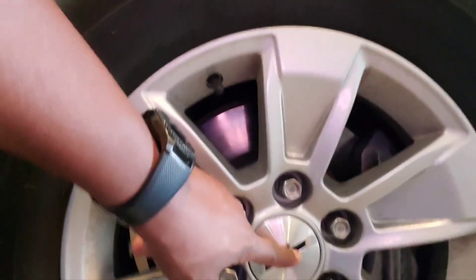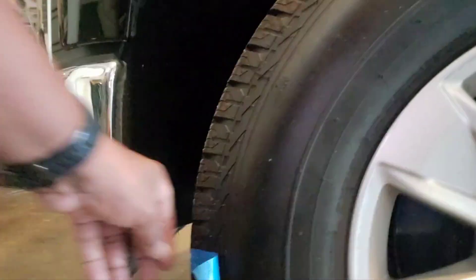The next thing I did was mark the tire. I try to mark it based off the center of the tire. I put a piece of tape about 15 inches off the ground — it should be in line — and a piece of tape on the back as well. I did the exact same for both sides. I then took heavy-duty tape and taped it into the first groove — that's where I'm measuring from, and you've got to measure from the same place on both sides.